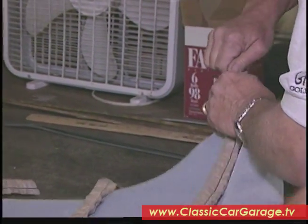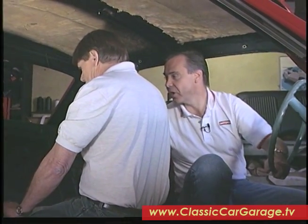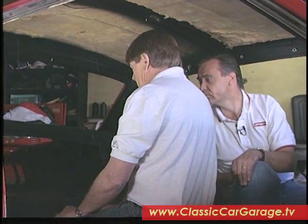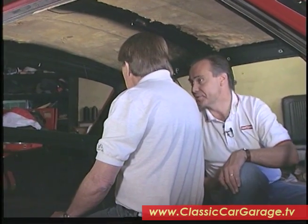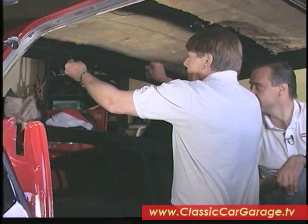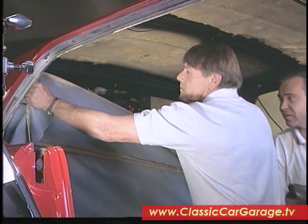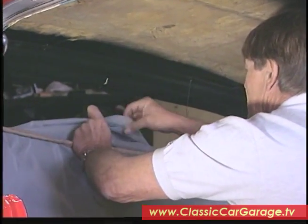Slide it on in — what you want to do is be certain you get these bows centered in the headlining. Now that you've got the bows and the headliner, we're inside the car ready to put it in. You've got chalk marks here — this is the center line on the car. It's important to keep your headlining centered all the way through the process of hanging the bows and stretching from side to side. We're going to start installing the headliner from the rear forward, putting these rods in the pre-marked holes. This car is very good because it has some anchor wires in the back which hold the rear bow in exactly the right position, so you know exactly where it's supposed to go when you're stretching it forward. You may want to check your center mark at this time — the headlining does have a center mark on it.